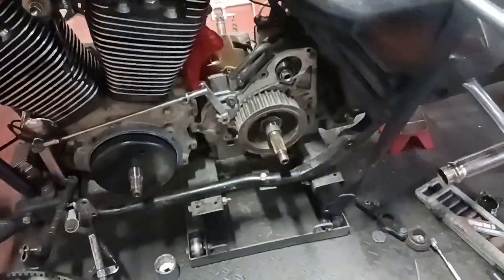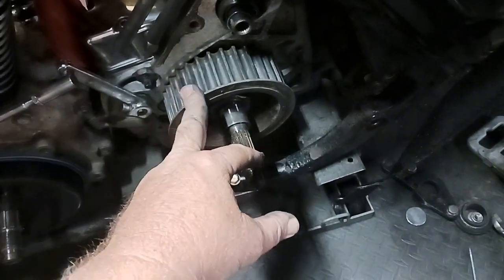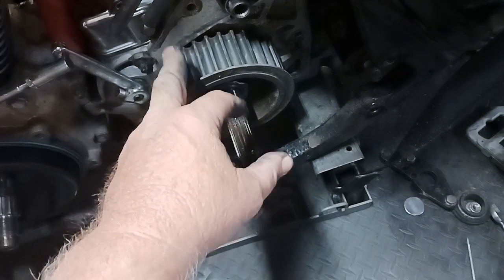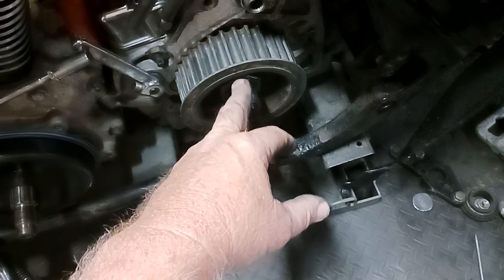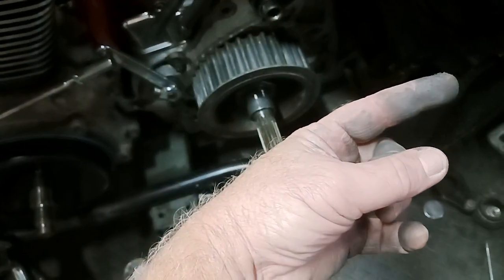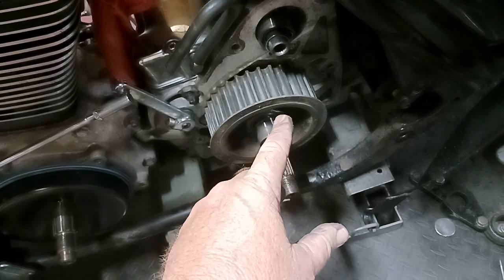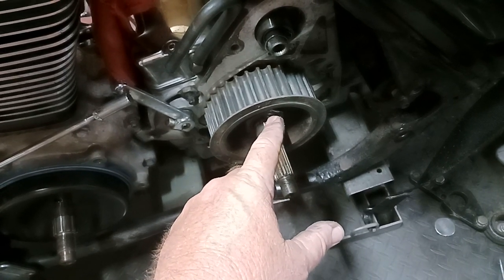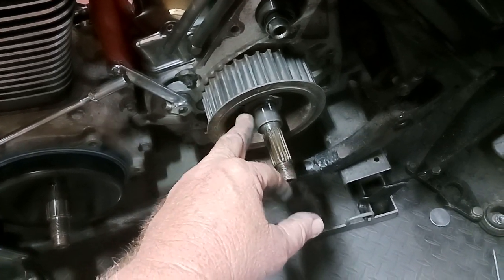I got to thinking - I've gone this far with the primary off and the wheel off, so I got a new belt ordered and I'm waiting on that. I figured I'm gonna try to take this pulley off too. I've never taken one off before. I've seen videos where they can be a real challenge, but I believe this is a reverse thread so it needs to go to the right. I saw one guy trying to do it to the left and he ended up cutting it off.